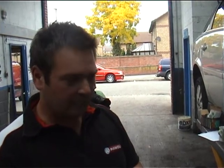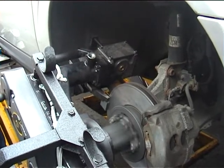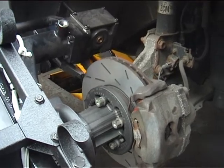We've seen today that we're cutting some EBC slotted discs, but in your experience it is perfectly acceptable to machine drilled discs and slotted discs fitted onto a variety of cars? Yes, it's perfectly acceptable — it's more than that, it's actually recommended by most of the leading manufacturers, for example Ford and BMW. It's all approved and recommended by the leading manufacturers. We can see the disc finish in the last stages of its cut now.